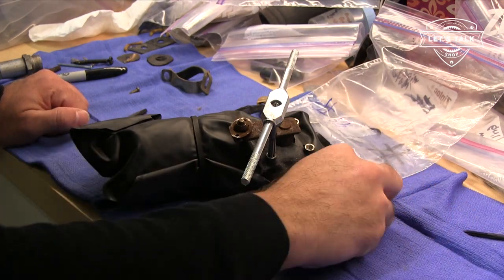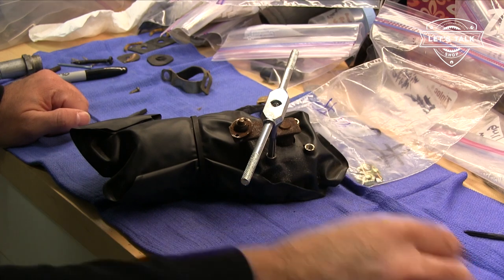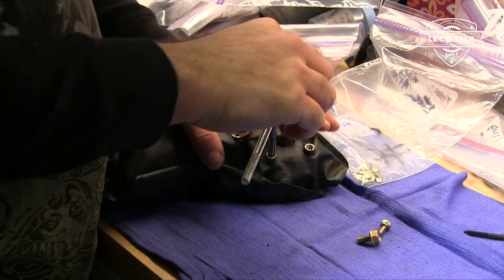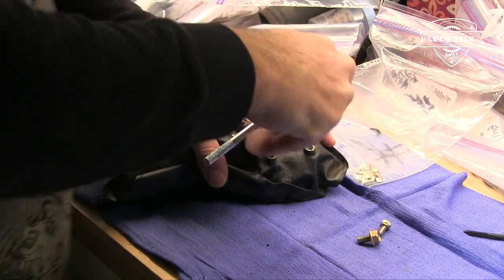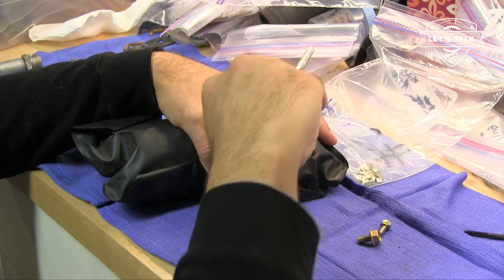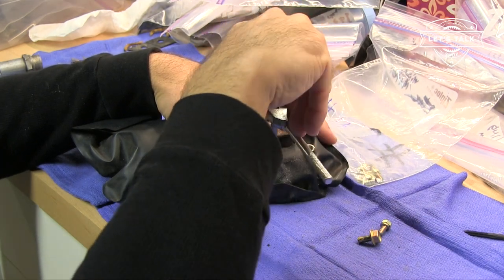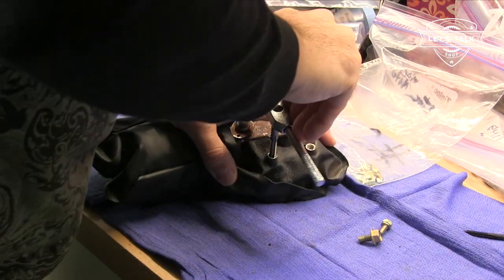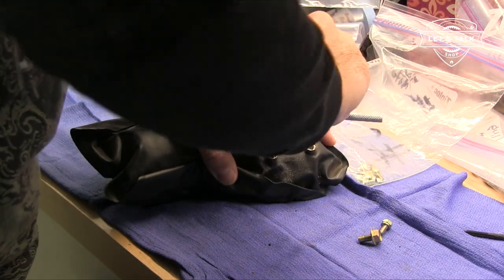5mm by 0.8 tapping went fine, but the bolt wouldn't tighten, so it just kind of sat there and spun. So, gonna upsize 6mm by 1.0, and again, making sure we go straight down here. This housing is soft metal, it's aluminum, so this is going pretty easy. I just want it to go straight and smooth.